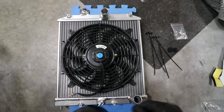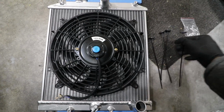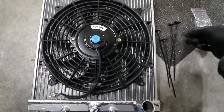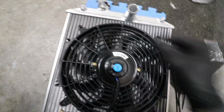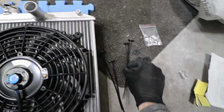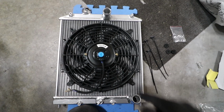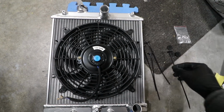Alright, so the fan right now is in the correct position of where it's going to be. The kit that I actually got here has all the hardware included with it, and these are basically like a nylon bolt. It's going to feed through, and then there's these little push nuts that I have that'll go on the other side that'll lock it in and hold this in place. It did come with these little 4 hardware pieces here just to make the mounting a little bit easier for this, as these holes right here just won't fit properly with the head of this little nylon bolt. I'm going to mark the 4 holes with a marker, and then just feed, as the instructions say, a screwdriver very small all the way through, and then I'll just start attaching this, and hopefully this will be it.